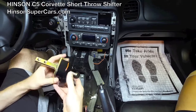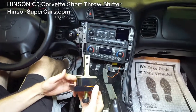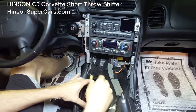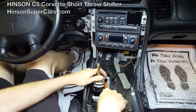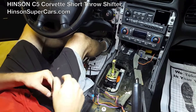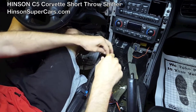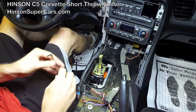With the ball in place, this shifter is symmetrical — there is no front, there is no back. This plastic ball will go inside the shifter location and it simply drops down on top of the shift box. Since there's no fluid here, we're not dealing with any mating surface gasket needed. The shifter uses the included hardware — it's a 5/32nd hex head. If you have a small quarter drive socket you can run it down with that, or you can use an Allen wrench. Leave the shifter in neutral so you're not fighting the tension of the shifter itself. Get all four of these in place and torque snugged down.